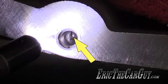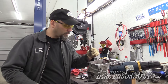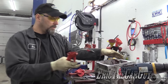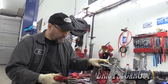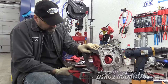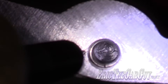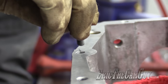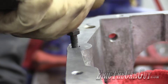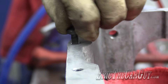Now you see that little tab down in there? We should get rid of that. A hammer and a punch will make short work of it. Put it on the end, give it a little tap, and get the remains out with a little bit of compressed air. And there we are — all cleaned out, re-threaded. You can verify our repair. Yay! Threads again.